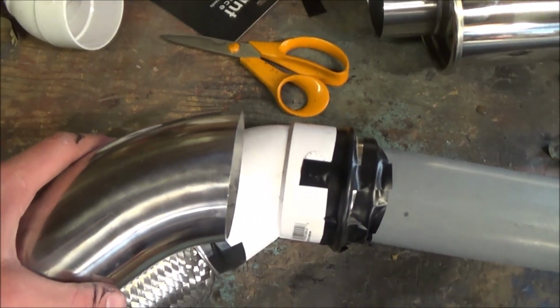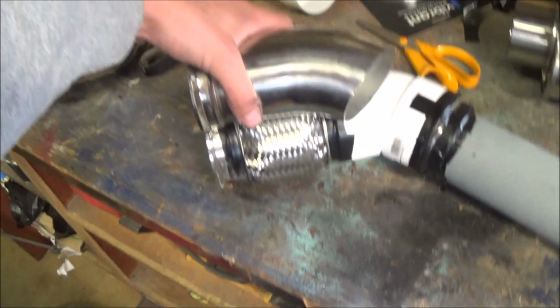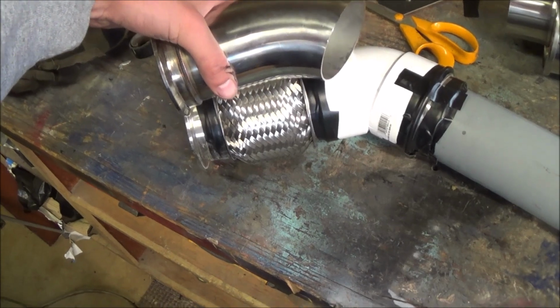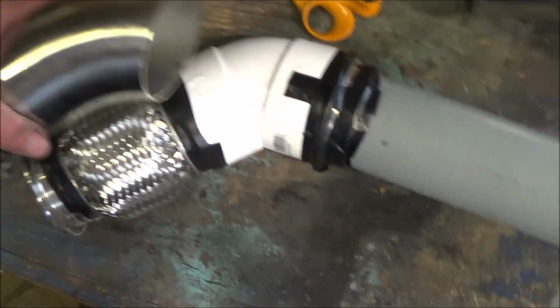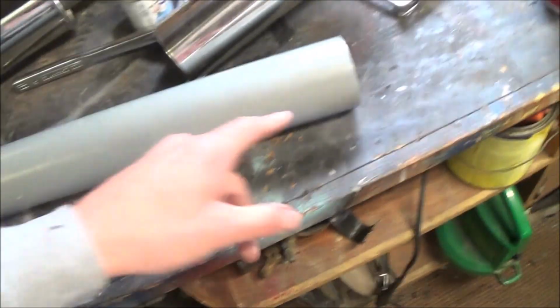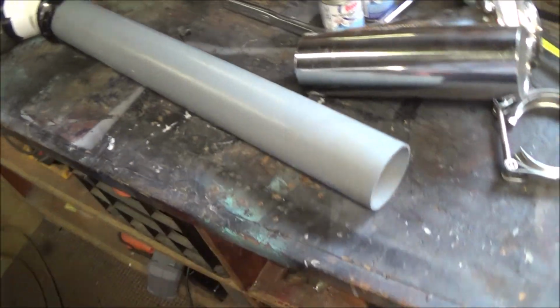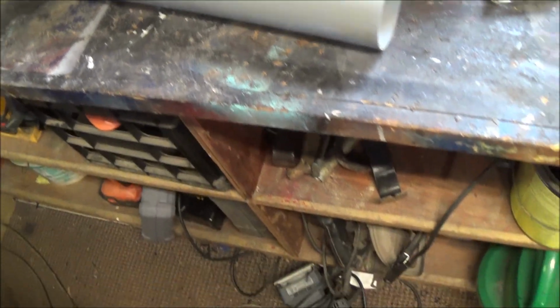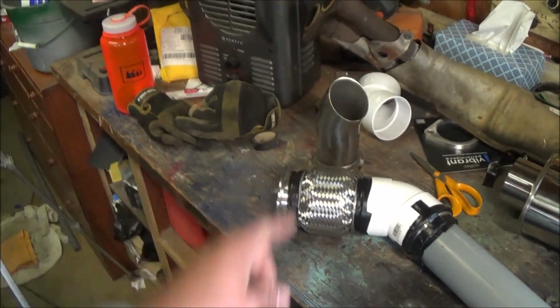Now I'm low-key wondering if I kind of actually want to just do this now, but at the same time, I'm gonna have to hop back under the car and see how this looks. But the way we're looking without this is just one bend. There's gonna need to be one more tiny bend at the end, which is why if I could just get one U-joint, that'd be great. Or one U-mandrel bend. And then this piping will be just fine. I'll get about another foot of stainless steel. That'll be plenty. I'll just get 2 feet just to play it safe. And we should be good. That's literally about it. So I'm gonna hop under there, see if that works, because if so, that saves us a bunch.